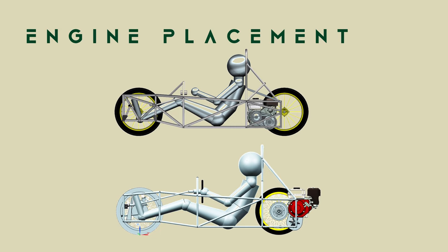Next, we look at engine placement. There are only two practical configurations: mid-engine and rear-engine. We've seen both configurations used on cycle karts and it seems to be driven by the proportions of the inspiration vehicle. For the rear engine, it does have a shorter wheelbase but a longer overall length which makes the proportions slightly off. It is easier to access the pull starter. The feet can be behind the front axle line which allows for tighter front suspension packaging. However, it has the trade-off of a higher centre of gravity, the weight distribution is pushed rearward, and it has increased yaw inertia, meaning the car will be slightly less responsive to turning compared to a mid-engine.